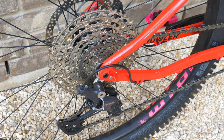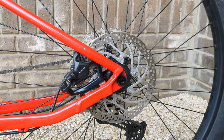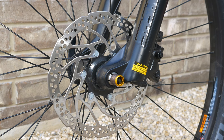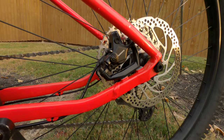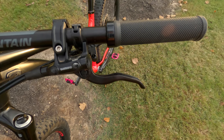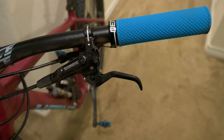It has a 12-speed Shimano Deore groupset, which we'll talk about the cranks a little bit later. Brakes are Shimano MT401 two-piston hydraulic disc brakes with 180 millimeter rotors. The pads are resin with resin-only rotors, which is pretty typical in this price range but also kind of a bummer. The levers are the longer two-finger style blades — they're fine, I just prefer the shorter versions.